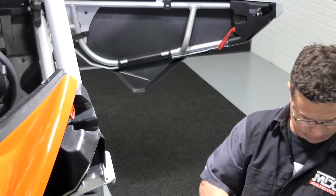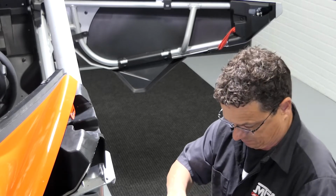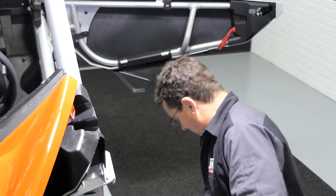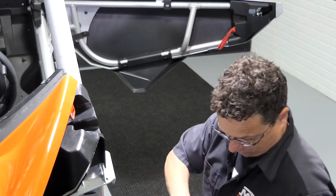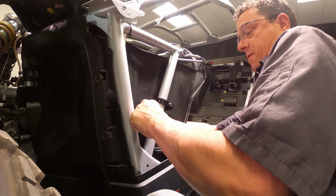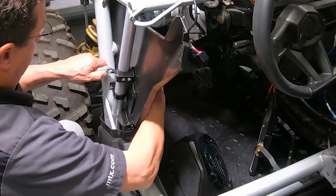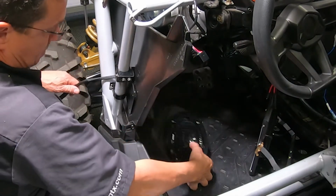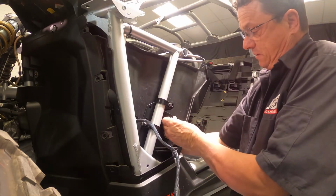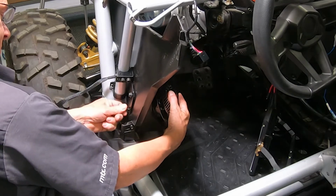Now we take our kick panel, get the wires freed up. I should have brought cutters, but I didn't. All right, grab your last four, 3/4 inch, 10 millimeters. You're gonna bring this around to the front. Feed your wires through the last remaining hole in the back, like this. Reaching from the inside, you should be able to line up and see the brass inserts from the kick panel.